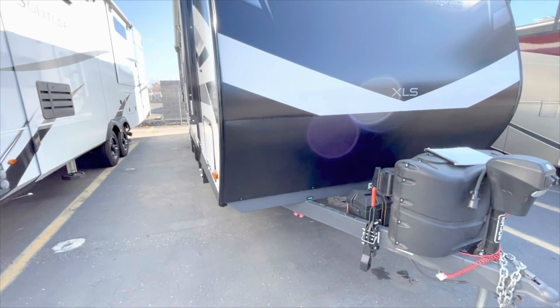Keep an eye on all your sealants on your lights. I'm checking all the little stuff, like the star washers on the awnings. I'm looking to see if the handles on the entry doors are secured — paddle locks, if they're loose or moving. This particular awning, if you look up here, I caught it earlier when I was looking at the roof — you can see the gimp cord is coming out of it. I'm always looking at the rails underneath, like this rail. You can see that big gap underneath there. That awning rail is actually coming loose from the coach, so I need to write that down.